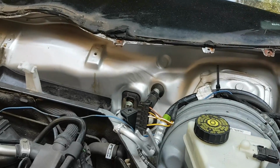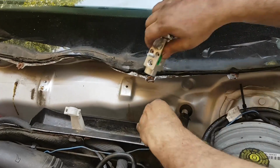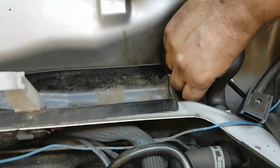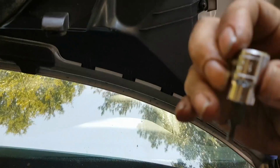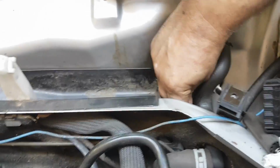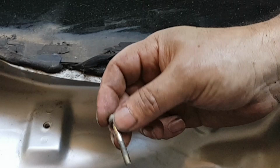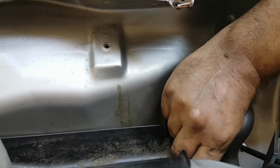Anytime you take out the pressure lines, make sure you cover the ends of the lines with something. I used aluminum foil here. And also when you put things back together, this is the 8mm socket that I use for the two screws. Anytime you put the lines back in, you want to make sure you have new rubber gaskets, or rubber O-rings they're called, and I'll have those parts in the description too.